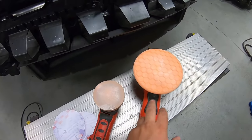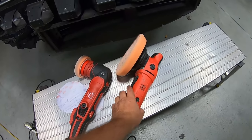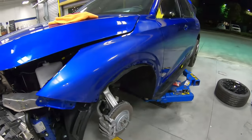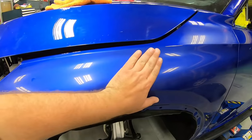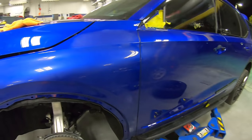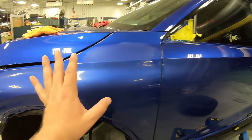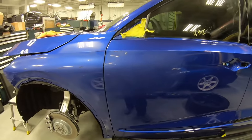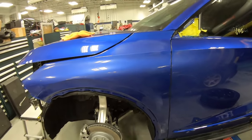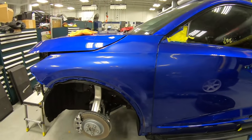We're using a combination of two buffers — a 6.5-inch pad and a 3-inch pad — and I just learned all about using this type of random orbital buffer. Sanding up to 8,000, you can see it's much glossier than the other side. You might ask what's going to be flat in this spot — well, there was a little bit of dirt and some fine texture. So I leveled it out to match the rest of the vehicle, and you won't see the transition at all. What you don't want to do is flatten it out completely with, like, 1,000 grit, because then that's a dead giveaway — it won't match the texture of the rest of the vehicle. We'll go ahead with that one-step once again and get this side finished up.